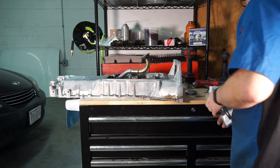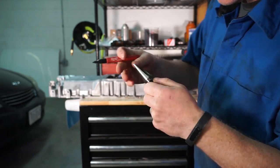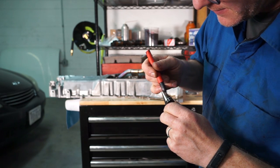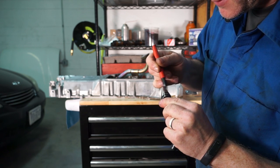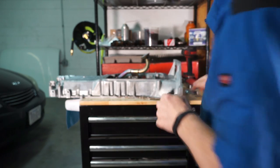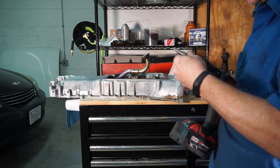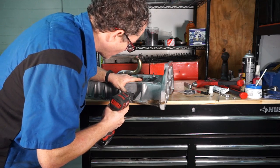And I did not bring a razor blade over, so I'll be right back. Okay, so we've got this out of the package and we want to drill a 3/4-inch hole. So I'm going to take a magic marker and color in the step that's right past the 3/4 line, which would be 13/16, so I know not to go to that line. And then I'm gonna be careful to be straight.